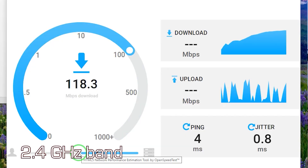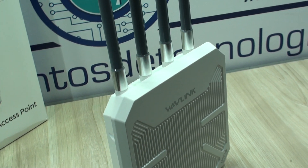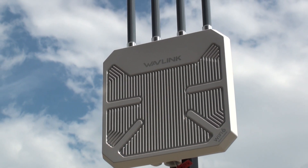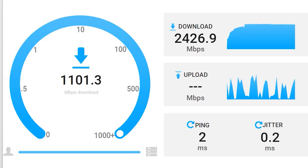As for the performance of this card, it was very interesting — here in Wi-Fi 4, this speed in Wi-Fi 5 or 802.11ac, here with Wi-Fi 6, and here with Wi-Fi 6 connected to different access points. In this case, the Wavlink outdoor long-range access point, which has extraordinary performance and range — and as we keep saying, Wi-Fi 6 continues to be a very valid upgrade. We ended up with Wi-Fi 7, playing around with different configurations of MLO (multi-link operation) even from the advanced drivers setup in the control panel, and we ended up connecting at a minimum of 2.5 gigabits per second in the 6 GHz band.